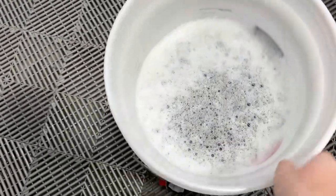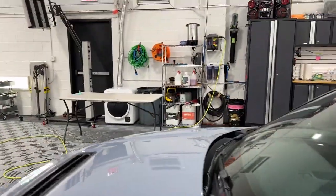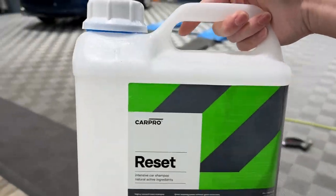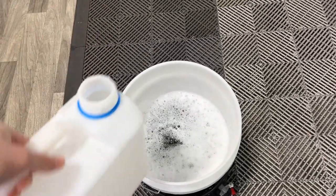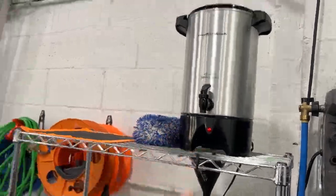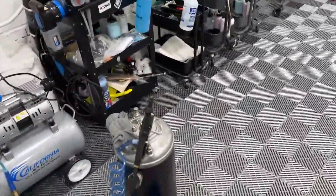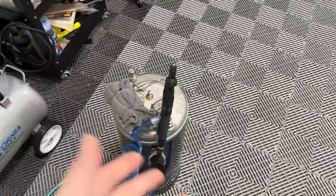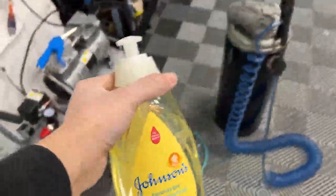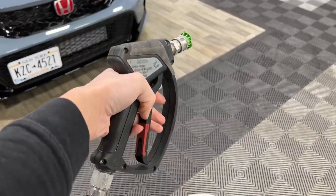First, as usual I've got my wash bucket — it's just filtered water and I'm using Car Pro Reset as the soap, just a splash of that to make my wash mixture. I've also got my tack ready, which is filtered water in a coffee heater. Hot water is good for tack because it makes the material more malleable and really lets the glue adhere. For my slip solution it's filtered water and Johnson's Baby soap or shampoo — that's the best soap I've found for installing PPF.